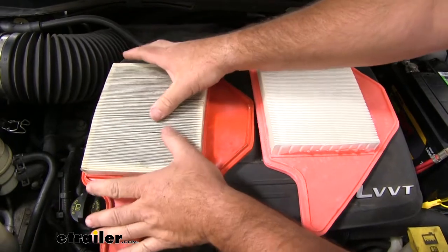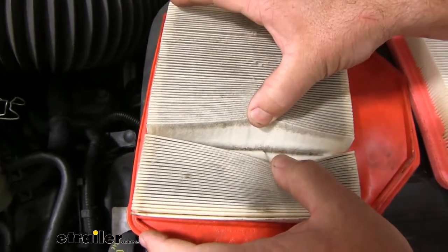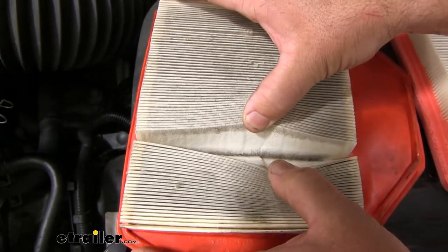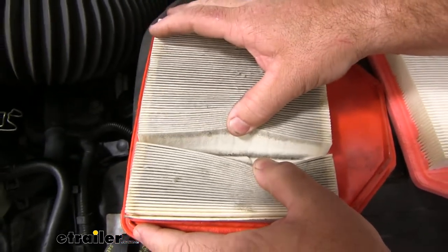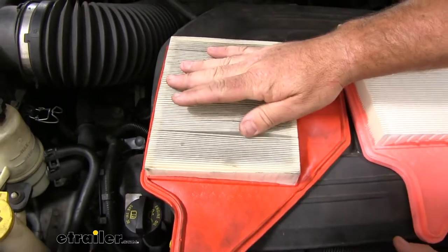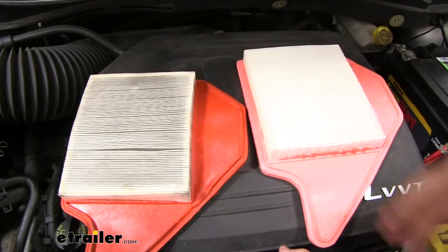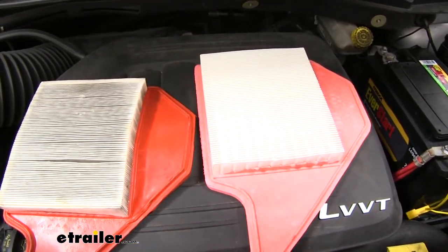Pull this up and remove your air filter. You'll notice on our air filter this one looks like it's been replaced recently, but you can see all the dirt that's caught down in there. The filter is doing what we want it to do by collecting all those particles. But as this filter fills up with those particles, what happens is you reduce the airflow going into the engine. So it's a good idea to replace these — look at them every six months, replace them about once a year.